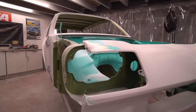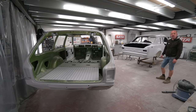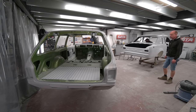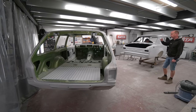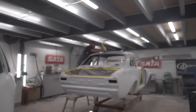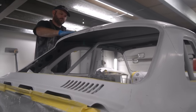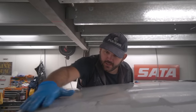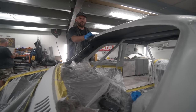It's been a couple of two-steps-forward-one-step-back on some of the front end on the Chevette — just panel fit-ups and flexible panels not being quite where they should be, all the usual panel fit caper. But Mark's been busy getting the front corners right and doing the final fettling necessary. That's then due for its final epoxy primer on all the outer front end parts; once that's done it can be blocked and it's pretty much at the stage of final paint.